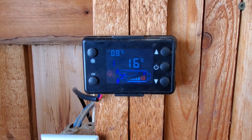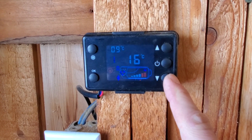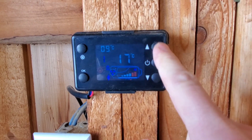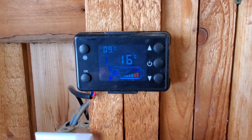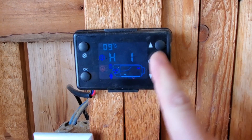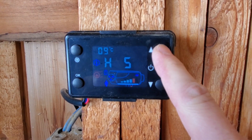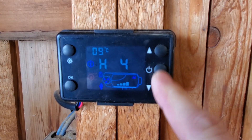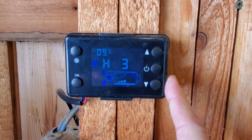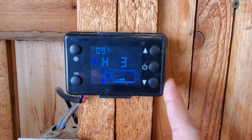This controller is one of the newer styles. It's actually not as good as another controller that looks just like this, but allows you to adjust the fuel pump dosing settings, which is measured in Hertz, and also the fan speed. This one doesn't have that option — I can adjust the temperature the heater will aim to hit and maintain, and then if I switch modes I can adjust the overall heating level, which goes up to 6. The other version, maybe the older version, is actually a better version — you can adjust a few more parameters. This works fine for what I'm using it for, but if I do get another heater I'm going to get the one with the Hertz adjustment and fan speed adjustment, because you can make a few efficiency improvements depending on your elevation with that model.